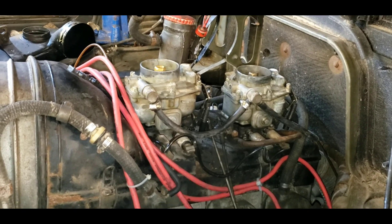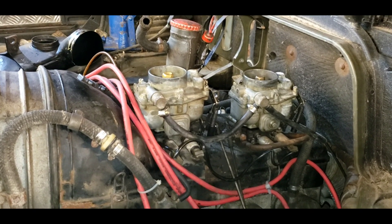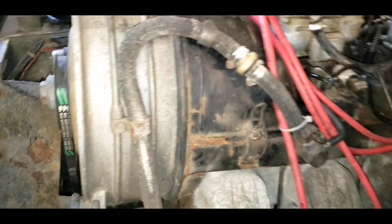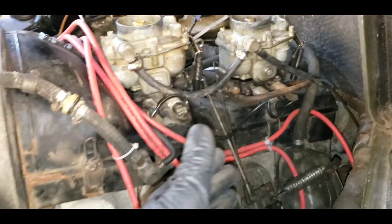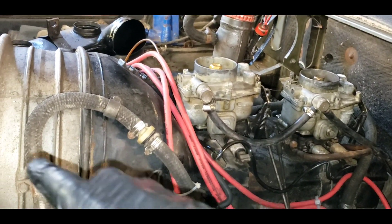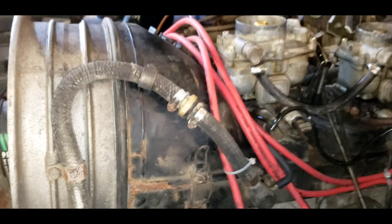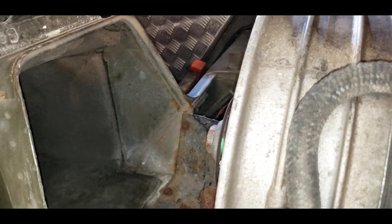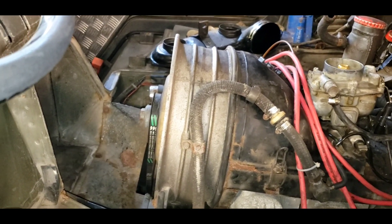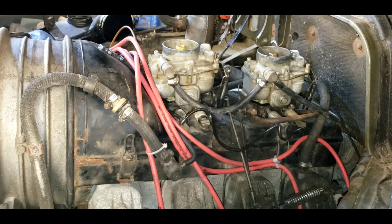This vehicle is stored on the Oregon coast and it's had a lot of rust and water problems — rust getting into electrical components, rust getting in the body, and water because the coast is very, very moist. The fan had sucked in a bunch of debris — leaves, litter — and it was plugging the tops of the cylinders. It was awful. That fan pulls in quite a bit of air, similar to a Porsche fan. It also can pull in through this vent where the radiator would normally be — leaves, garbage, papers, pine needles, wrappers, plastic bags, you name it.